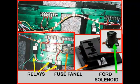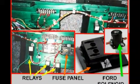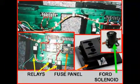All these electrical items required a lot of custom wiring. The Painless wire was used to activate a high-current relay to a six-terminal fuse panel that provided 12 volts to many of these accessories. Terminal strips and relays were used to keep the high-current wires short. That included a Ford remote starter solenoid so 12-volt power to the Chevy starter was only supplied when actually starting the car.